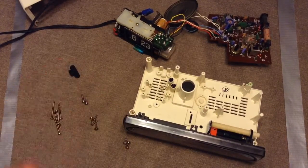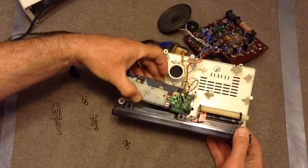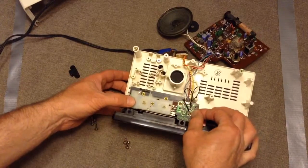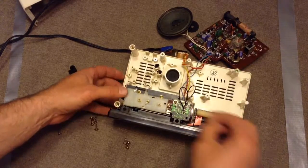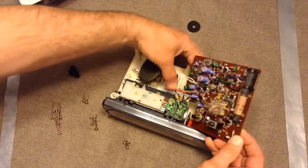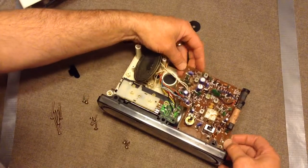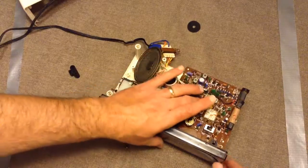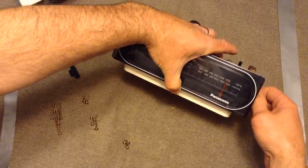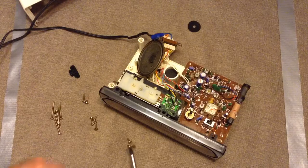The selector's in place, let's start getting things back together. I like to get the clock in first — you just angle it in and wiggle and jiggle it. First couple of times you'll think it won't go back in there, but trust me it does. I'll put the circuit board up here. As for where the wires go — don't sweat it, just little knobs and nubbies show you where it goes. Now I'm holding my finger down here and I'm going to turn it all the way left and right to make sure I'll get all my stations.